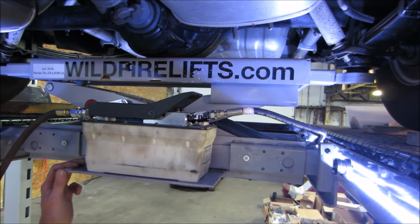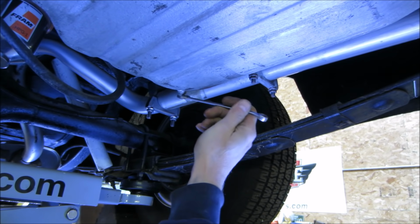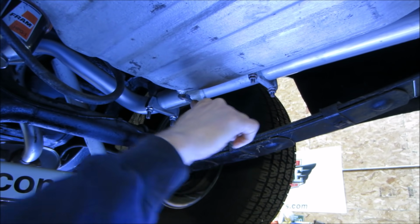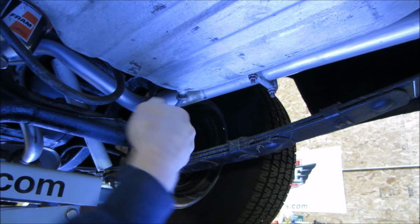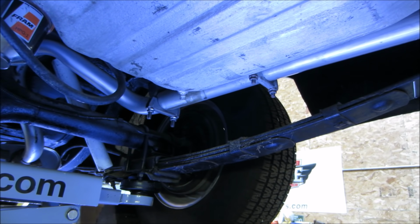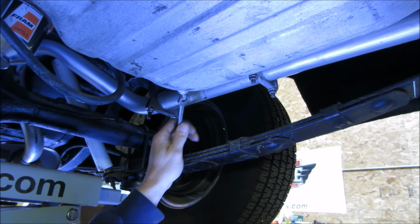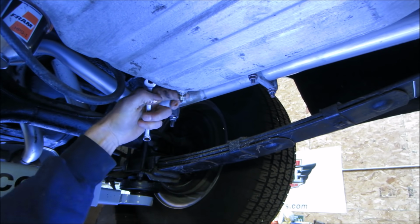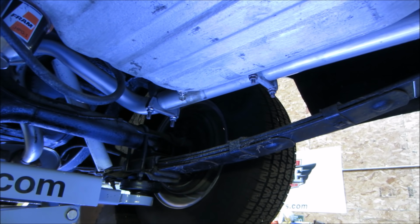That's good, well, as long as the tires are off the ground. We're back by the tank and it's got a little drain on it. See if that'll move for us. See if we can get gas out of it and what it looks like if there is. Hopefully it's dry because I don't know how long this car's been sitting. There is something coming out of it. I'm gonna get a cup, let it fill up and take a peek at what color it looks like.